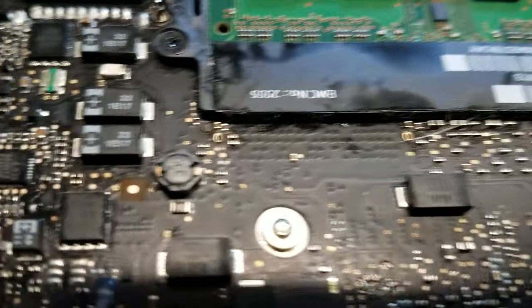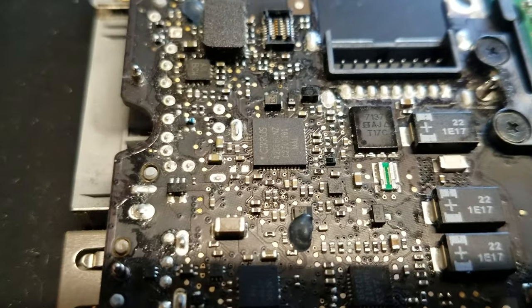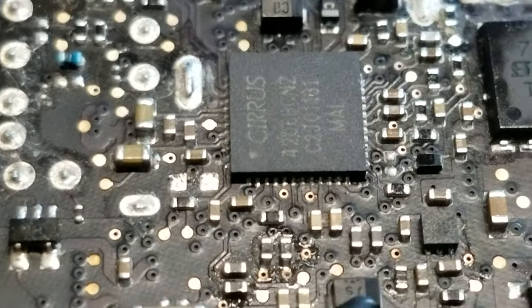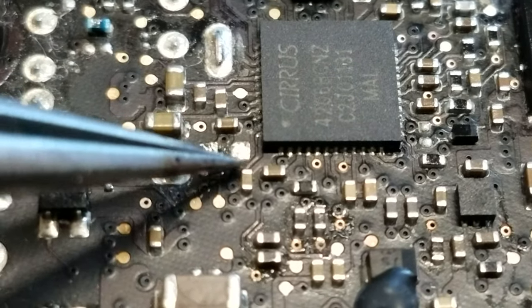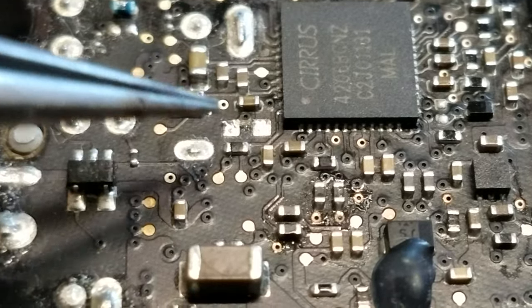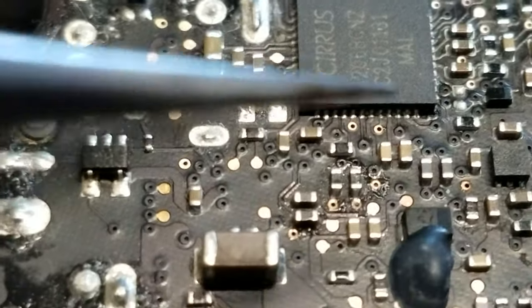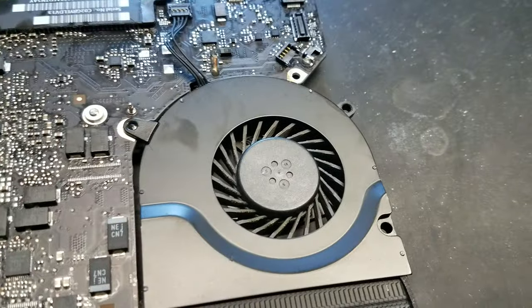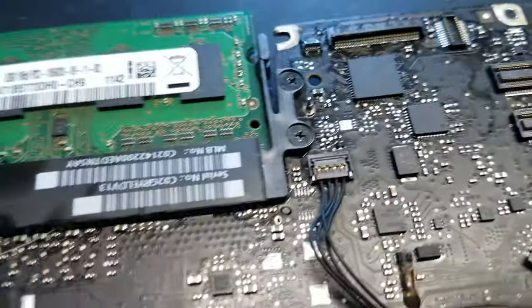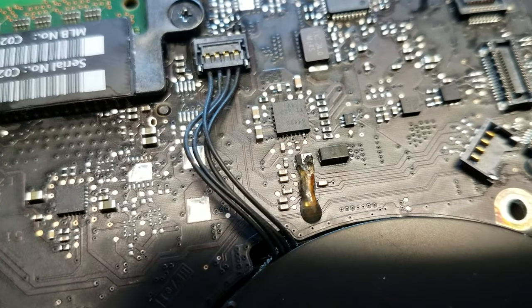Well, if you come over here, this big IC here is the audio chip. There's a capacitor here — it's missing now — but there was a big capacitor here with one side on PP5ES3 shorted to ground. When I put alcohol on it, it was bubbling and hissing and would immediately disappear. So I desoldered that capacitor, turned the board on, and got a fan spin. The board is now working, and I want to apologize to U7200 and Q7221 for blaming you.